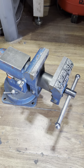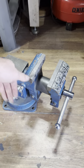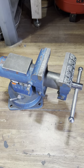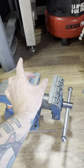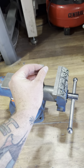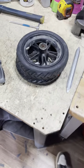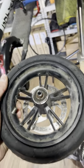Most importantly, you will need a vise. This is the one I've used — I've done hundreds of these electric scooter tires. The heavier it is, the better. Basically, what you'll do is clamp the solid rubber tire and dry rim into the vise to hold one side of the bead on while you work the rest of the bead around.